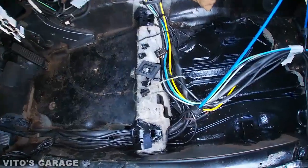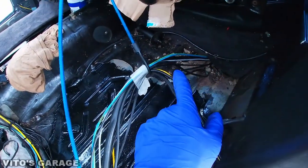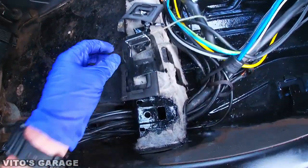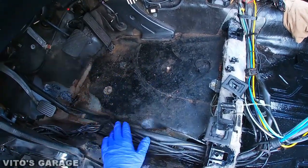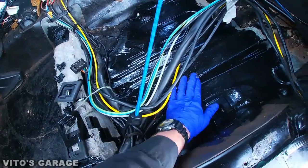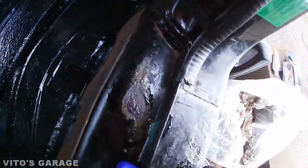Here's the deal — this is all drying up nicely, it's all actually dry. I painted this area nicely and I haven't gotten to the rear section yet, but I will soon. All these brackets are also painted, cleaned, and protected, and these mounts as well — as you guys remember there was rust on them, and that's all done now. I'm gonna get to this front section later, but right now I want to put the carpet first and then the seat. Before doing that I'll put some wheel bearing grease right here to protect it even more, and I'm gonna spray oil inside all these holes.